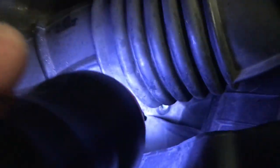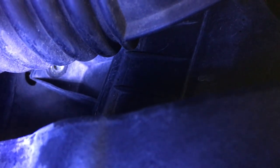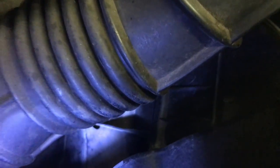That's on the right bank. When you come to the left bank of the motor, come down by the air part — it looks like someone was in there trying to get to the oil leak and coolant, and they were getting ready to pull the air box. If we look in here, there's an actual bolt missing. You can see the hole right there — my light's flashing over it. There's a hole there with the metal that actually goes to this air box piece that gets snapped down with the air cleaner. That's on the left bank of the motor as well.